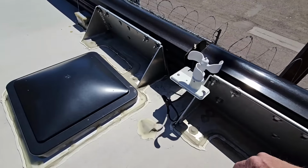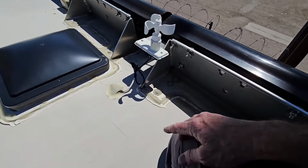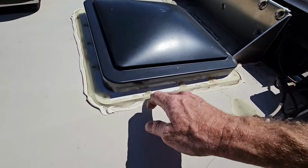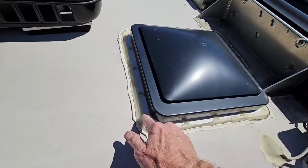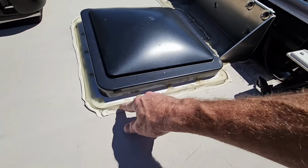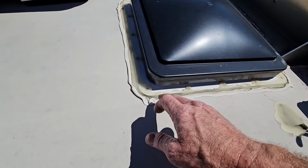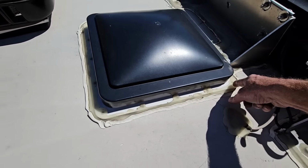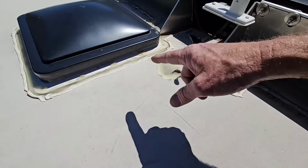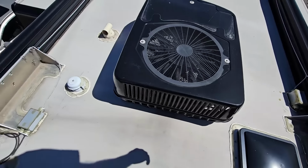And looks like they have replaced the wind sensor here. So this one's not broken, and it looks like they did make the connection up here with the heat shrink. And they did get the sealant underneath that cable entry port. Again, I'm not really quite sure why somebody touched this up with non-self-leveling sealant next to what looks like ProFlex or Pro Seal, because it does tend to yellow. And I don't know, I guess I could recommend this, just it's resealed right there. I'm not seeing an issue over here. I just don't know why they resealed it and did such a weird job.